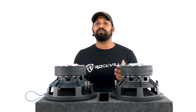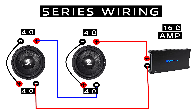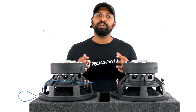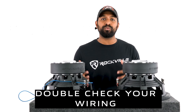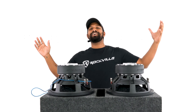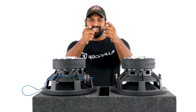There is another wiring configuration I want to mention — series wiring. This is not a very common configuration because of the amount of power you will lose from your amplifier to your speakers when running them this way. In fact, if you feel you're not getting the power you want out of your setup, you might have your subwoofers wired in series — so double-check against the other wirings we covered. I hope you found this video helpful on how to wire two DVC 4 ohm subwoofers. I'm Mike from Rockville — see you next time.